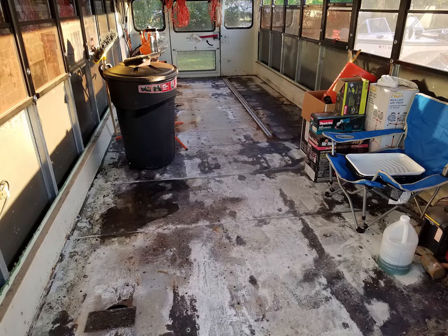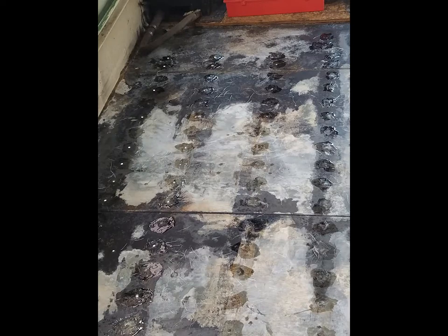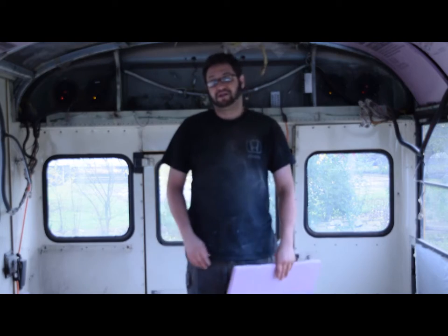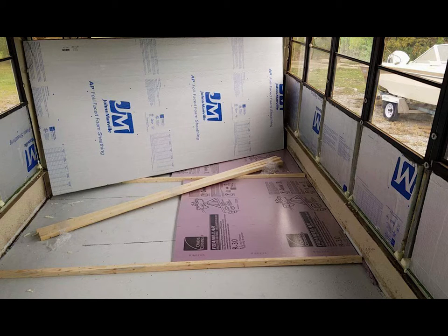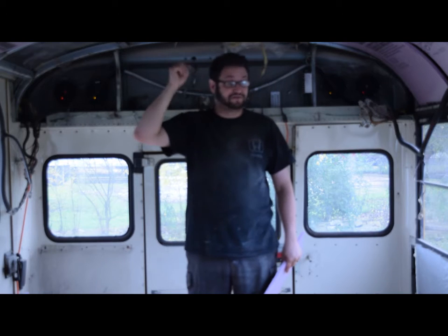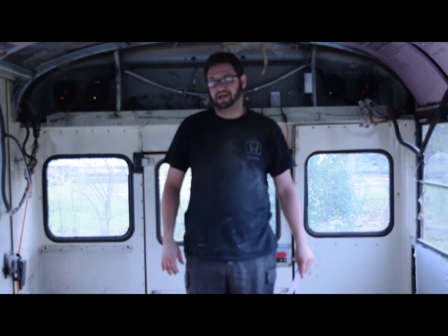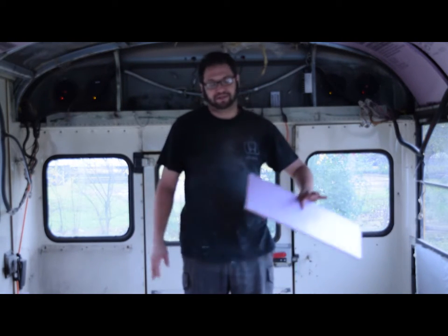I have taken out the floor completely. I got rid of all the rust, converted it, fiberglassed it, and painted it over the floor. After painting, I laid out my floor framing — basically every four feet or so. I made a mistake: I did 48 inches instead of 47 inches. You do 47 inches so that you have a half inch on either side of your 2x2 which you're using as the frame to drill into. I had to make some alterations, and it works out as a threshold where my bed's going to end.